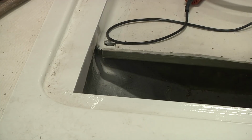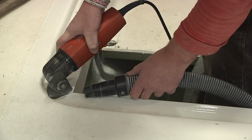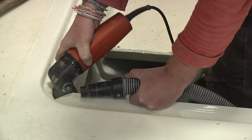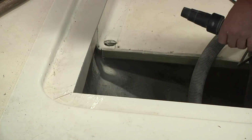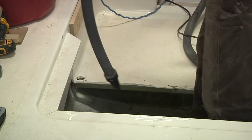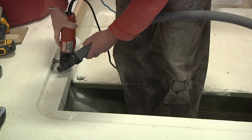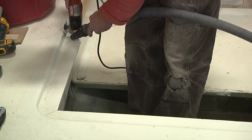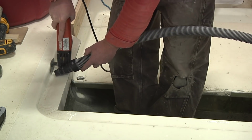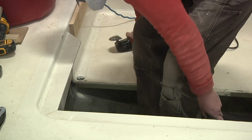So the material that I'm removing here is what's referred to as G10 composite. Essentially, it's a fiberglass laminate that's most of the time made using epoxy, but I believe you can also get it with polyester and vinyl ester resin. It's put together under vacuum and then heated for its final cure. You can get it in pretty much any shape, including panels, at different thicknesses, I-beams, squares, ovals, what have you. In this particular instance, it's probably closest to 90-degree angle iron.